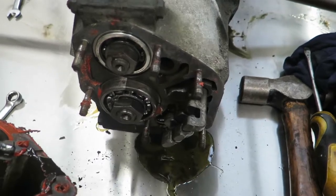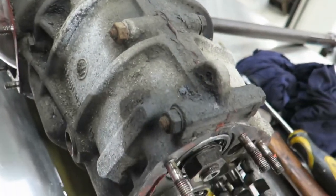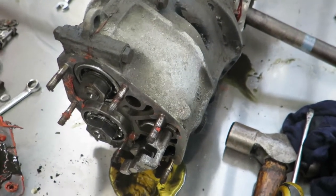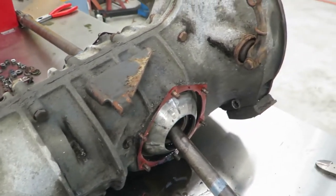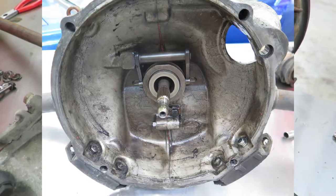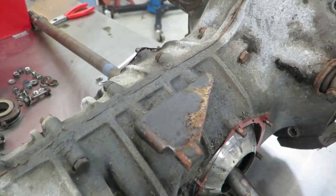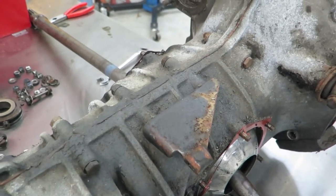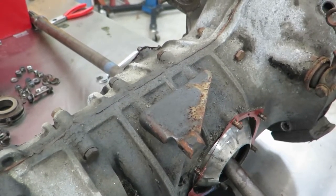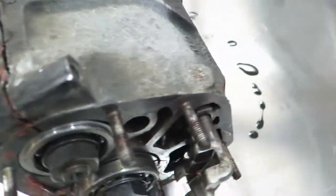We've got that rear housing off now. You can see the shift rails on this side. I'm going to roll it once we take these bolts out along here - roll it down on this side so the shift rails are on top, and hopefully the top will just lift off. When you're pulling stuff like this apart you obviously have brackets and bits and pieces that need to go back on in the right place and the right way around. I always take some photos just so you can get them back on right the first time, because it's a real pain when you've got a bracket that bolts through the case, put it back in the car, and then realise it's flipped the wrong way and doesn't fit. Easy to take a few pictures because sometimes the memory will just fail you.